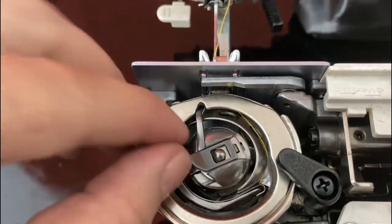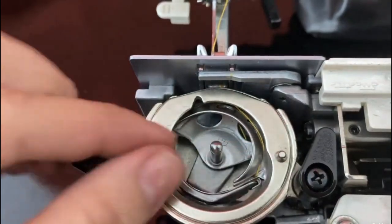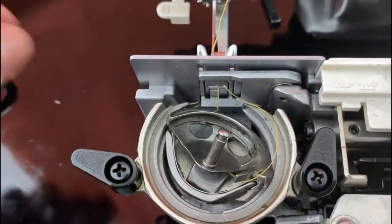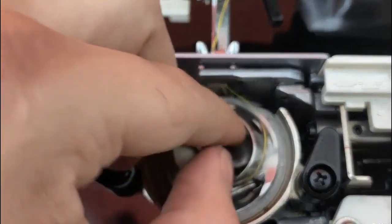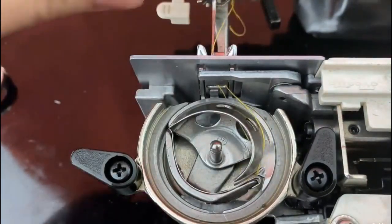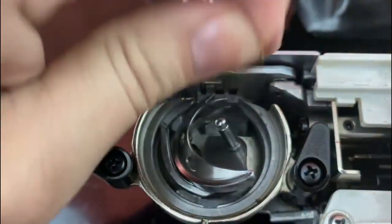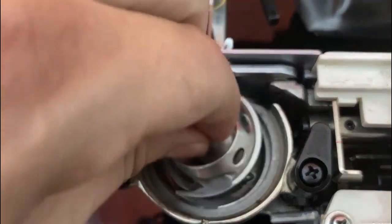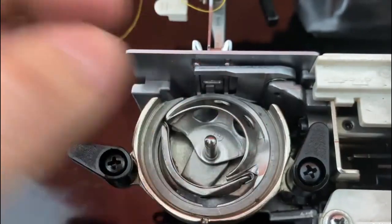The next thing we're going to do is take out the bobbin holder with the bobbin. Let's go. I open the openers. Let's take out the hook retainer, and we are going to leave the bobbin in that part, well lined up so that it is much easier for us to make the adjustment. We place the bobbin thread. We adjust the hook again, and let's see the next step. Remember, we need to do this when it's at its maximum stitch width.